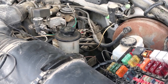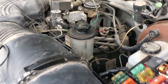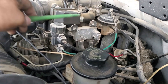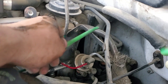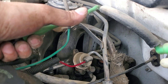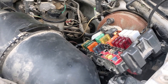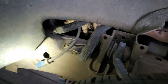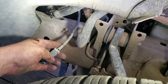There are a few typical areas where you'll find a short to ground. Generally you'll find it where a wire is rubbing on a bracket — over time the vibration of the truck causes a tear in the wire. Another common area is near the exhaust, which is actually where I found the source of our problem that kept burning out these fuses.